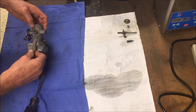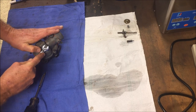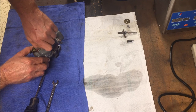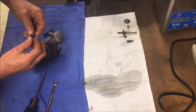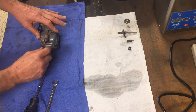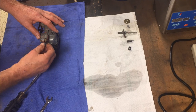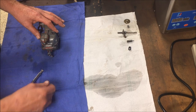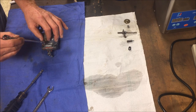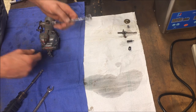Let's remove the bowl drain and clean that out. Now this is going to be your main jet. From reading the manual a few days ago, the starting point on the main jet is one and a half turns — right there. One thing about this main jet: before you go turning on the T-handle, you need to make sure the packing nut is loose. Once you get it where you want it, you can hold it in place and tighten the packing nut, and that'll keep it in place and keep it from leaking.